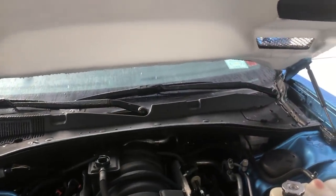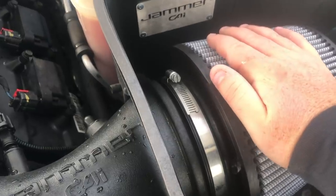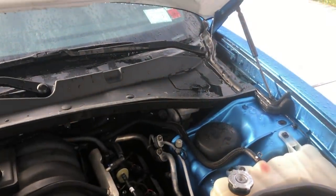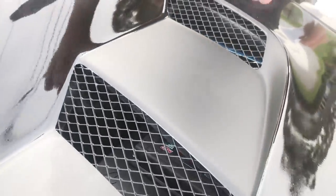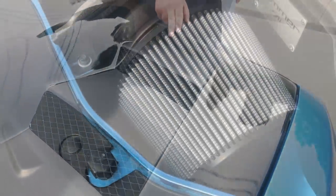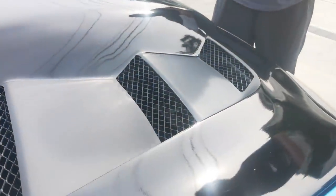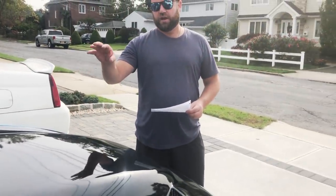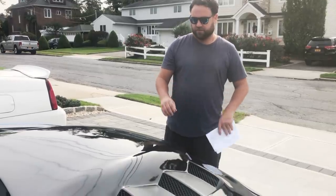There it goes — the air filter is looking pretty damn good. Not bad at all. The overall design of the way these vents are arranged means a very minimal amount of water gets in, but if you do have an exposed air intake, your air filter will get a little wet. That's a situation I'm going to be figuring out. I'm going to make a video on some of the options you have if you go out and get a Sniper hood, a Killer B hood, or a Hellcat hood — I'll go over a couple of solutions that will help you.